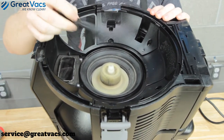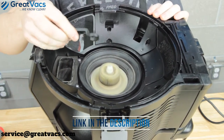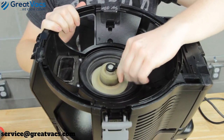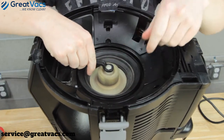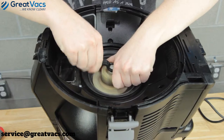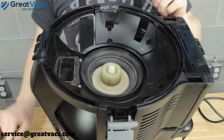If you don't have one of these plastic wrenches, we sell them — we'll put a link in the video description. Since it's plastic, it won't harm your water separator nut. Just put it on there, grab it with one hand, grab the water separator with your other hand, and twist counterclockwise — lefty loosey — as you turn the water separator to the right. It should come loose.